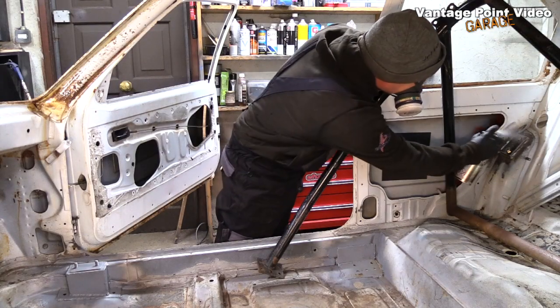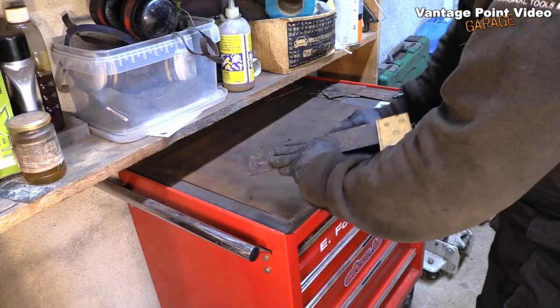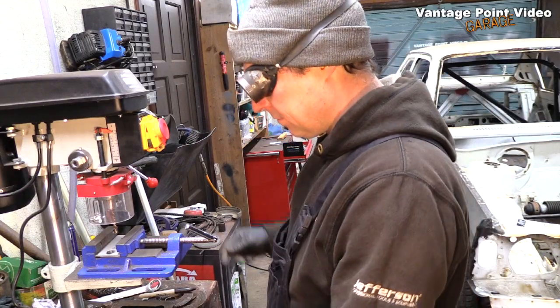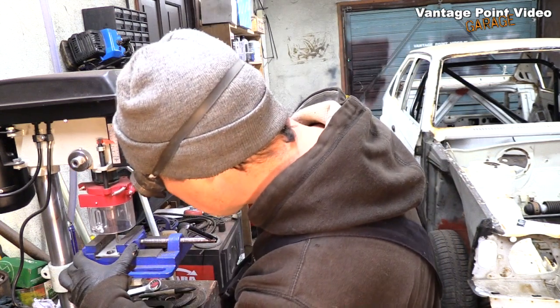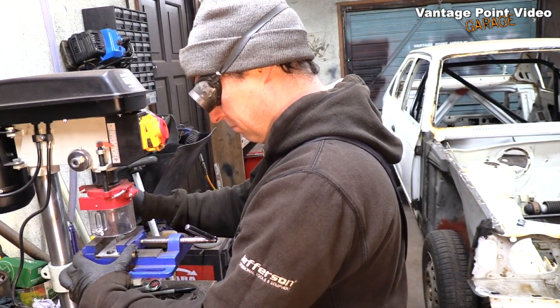I have the little footing sitting on the mounting so I'll put a bit of weld-through primer on that and take a quick break. Reminded of that additional bolt hole, I decided to mark the plates and drill that. That's one of the original underfloor mounting plates, so I'll copy it with a 12mm hole through the center, starting at around 4mm.